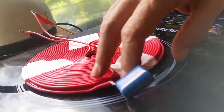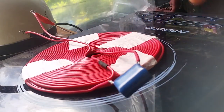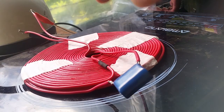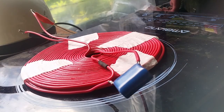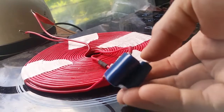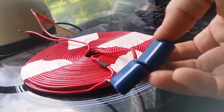I've tested this resonator cap — this resonator cap circuit is 13.8 kilohertz. So we're not on the 17 kilohertz target. If I put two caps there it gets me to nine kilohertz, which gets me to the half wave. I could then down-tune it with a little bit more capacitance until we're right on half wave.